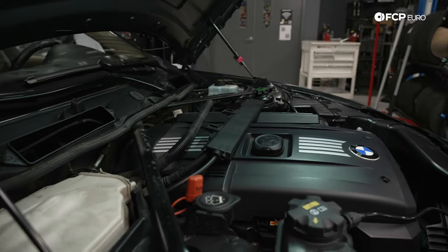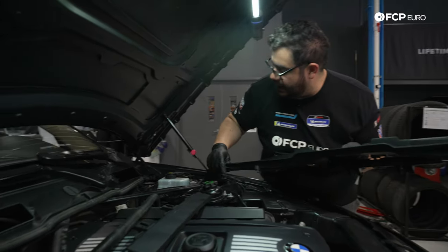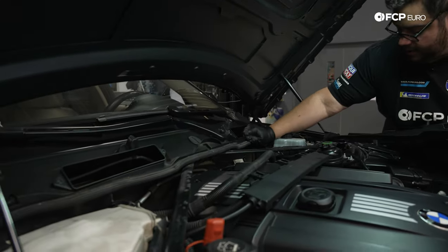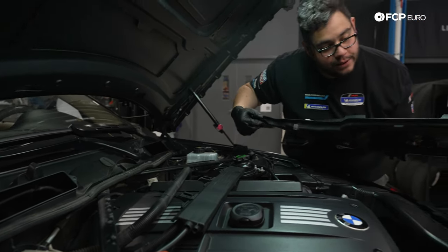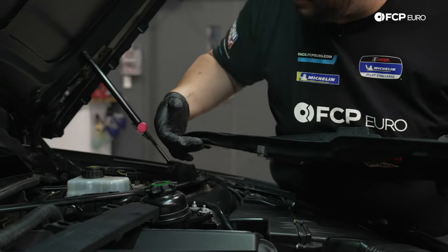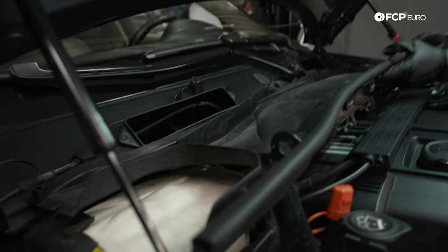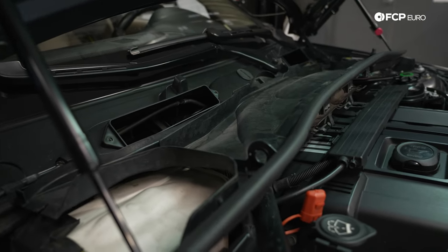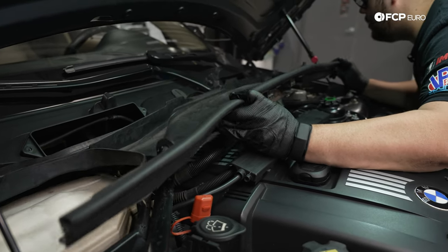With that, now we're gonna grab our actual cowl. This is basically just gonna key in to the top of the seal right here. You see these little tabs, we have one on each end. Those are gonna pinch the seal. So this is gonna sit against the top, this will be on the bottom. We're gonna go in at an angle, make sure that we're pretty aligned. Look at the ends where the 8 millimeter bolts go and see if you're close.